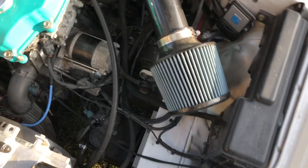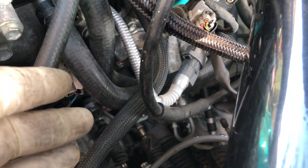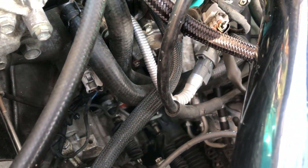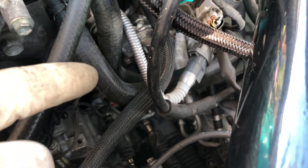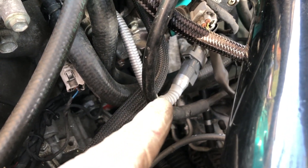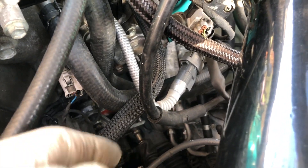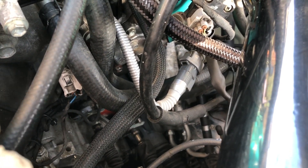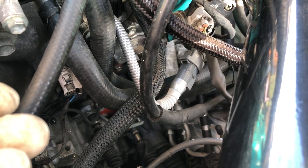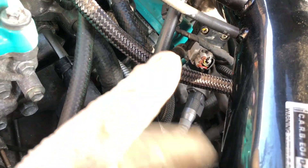Everything's back installed, though I did have a problem with the connector — it seems to hold but when I pull on it the clip doesn't do its job. When I put the OEM connector back on it holds perfectly fine, but I don't know why this aftermarket one isn't clipping on. If it comes out while I'm driving, I kept the OEM one so I can swap the wires over to the plug that actually works. I could also zip tie it to kind of hold it in place — it's trial and error. For now it's holding, so I'll leave it alone.